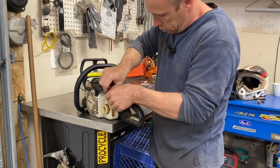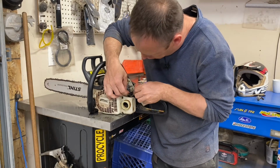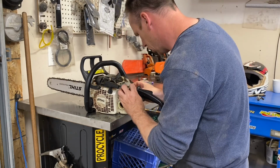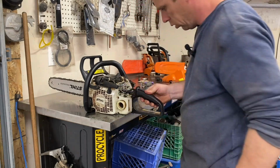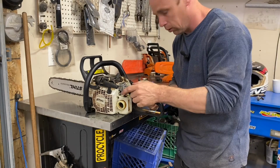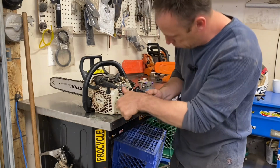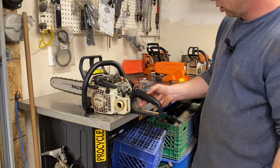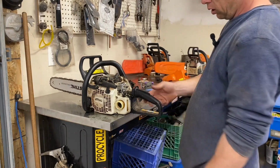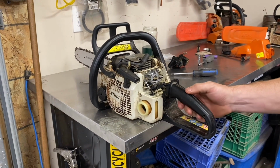So then you got the choke lever. It goes in the end of this little plastic rod here, like that. And you just put that end in there. You want to have the trigger in while you're doing this. I'm used to it, so I was kind of letting it go, but you don't want to learn the hard way that you should. And then just put that end in, and then full throttle. I think that's it. But on the throttle lock, on full choke, then move it to half choke. Snaps all off. It's back to idle.